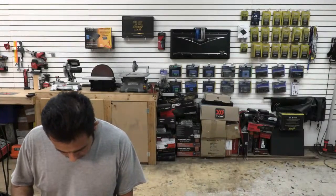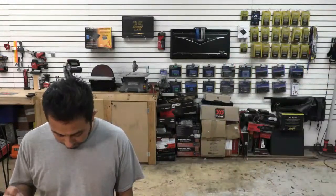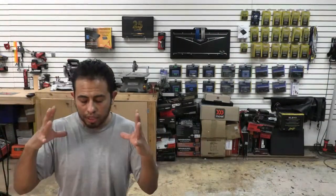Oh, no, never mind. I'm sorry. It's a TL. Okay, an Acura TL. So he's got a Honda, so he needs to cut the doors. We use an air saw. We'll come back to the 6x9. So to cut the doors, we use an air saw. Buy speaker adapters, put them on, mark with a Sharpie whatever is on the metal, and just cut it.